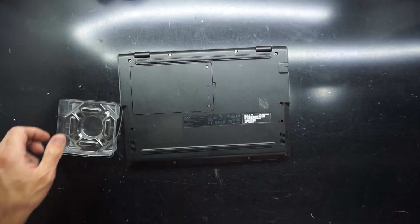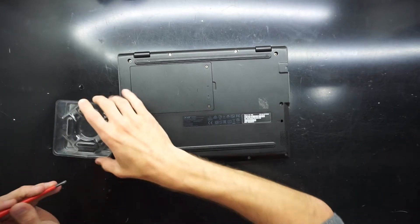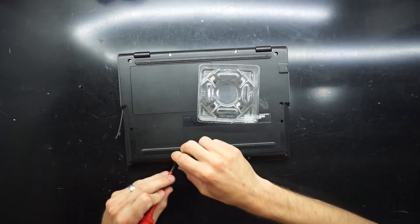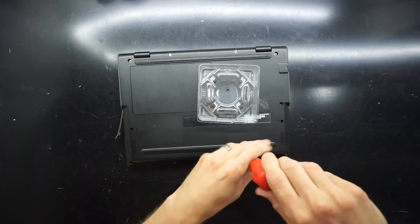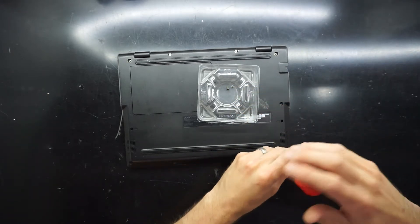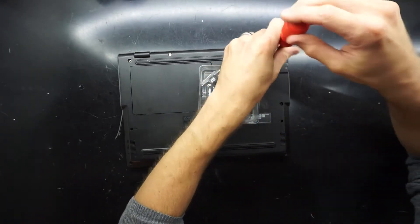I will be tearing this one down, which you can do with a relatively standard Phillips head screwdriver — it doesn't really have to be a small one. The reason for this teardown is to find out what battery is in this one, as it comes in two different models, and one battery is not interchangeable with the other. So I'll have to pull this machine down twice to find the correct battery for it.